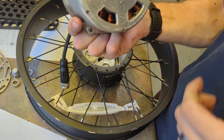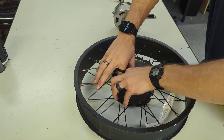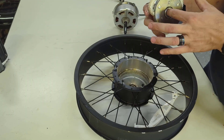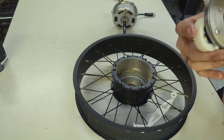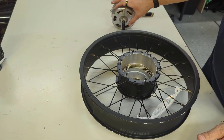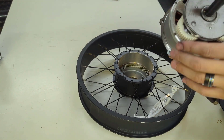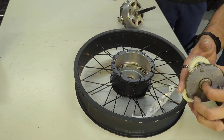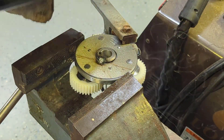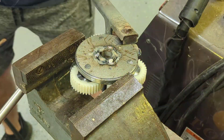You can take a look at this gear and clutch assembly, and we've got that keyed shaft. The original clutch is a freewheeling clutch, and the reason they do this is so that you don't experience motor drag when you're not pedaling. This is really good for helping it feel easier to pedal if the motor is not on or your battery is dead, but obviously this doesn't work with the regenerative braking setup.